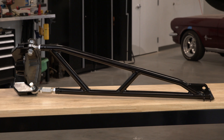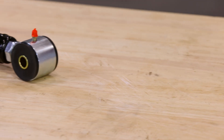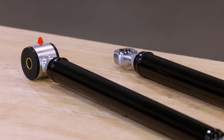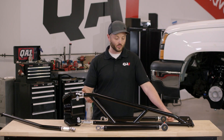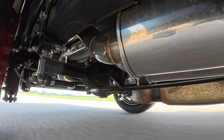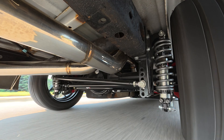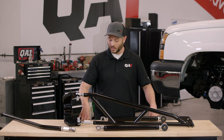Let's take a look at each part of the torque arm system. We've got the torque arm here — this holds your axle in place front to back, and it also allows you to adjust your pinion angle. Additionally, we have trailing arms. Those help keep the axle placed front to back as well, but they'll also control how power is applied through the chassis. If we change the angles of these bars, we can tune how much bite and traction we have. That can really affect straight-line performance, improve you at the track — the drag strip specifically. We can also flatten them out and tune the rear system for flatter handling, better cornering, limited body roll, rather than a drag race setup. It's a super versatile system with a lot of tunability.